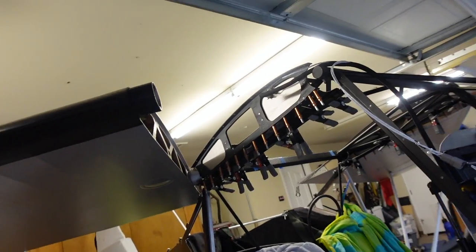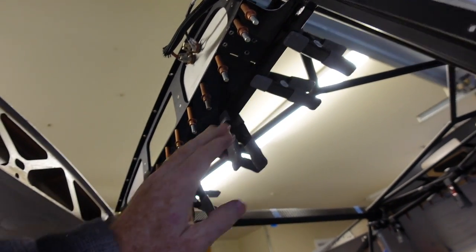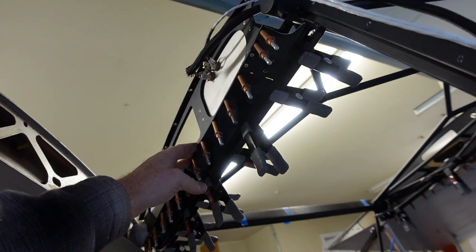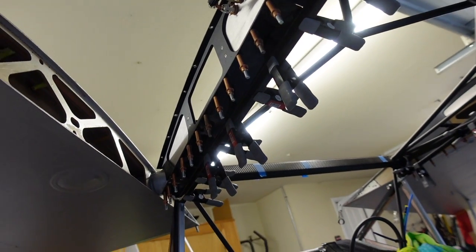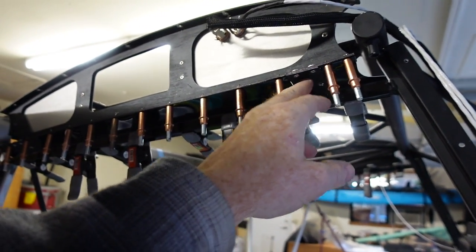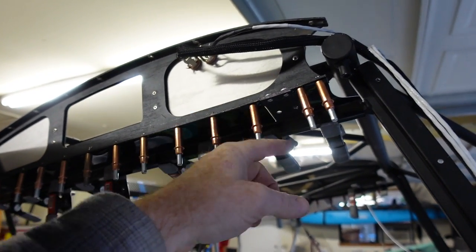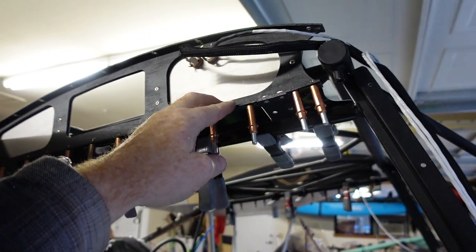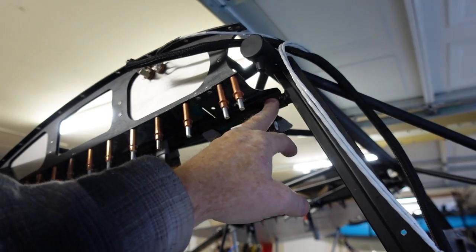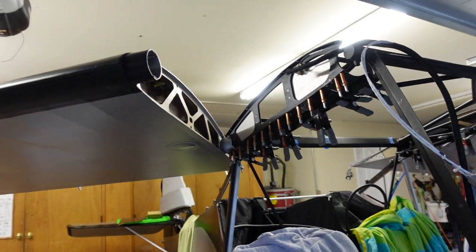I'm doing these butt rib closeouts — that's this piece right here. It connects the butt rib to the door frame and closes that out so you don't have a gap. Some guys have used fabric to cover that. These pieces were part of the prefab kit and there are no instructions on these. I did cut out where the tab holds the butt rib, and I'll put some sealant in those little gaps there. But laying it on top moves your door frame down the thickness of the aluminum, so I went and cut them out. There's a channel that goes around the door frame that's going to be glued in place, and I drilled and clecoed where the rivets are going to go. So it's all fit now.